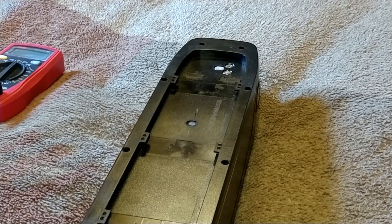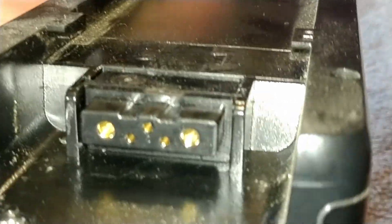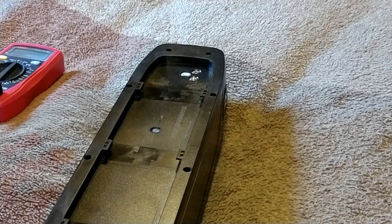That's a quick tutorial on how you check the actual voltage on your battery. I had a battery charging video where we talk about certain things, and once again I will emphasize: while you are charging that battery, do not turn the power on to check things out on the bike. In case you get a power surge or something goes wrong with your charger, you don't want all that extra juice going to all the other components on the bike.